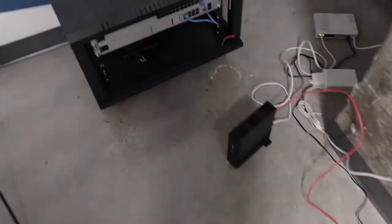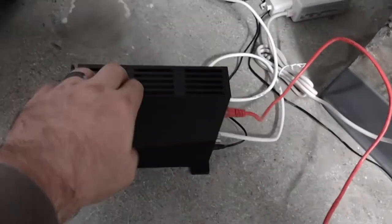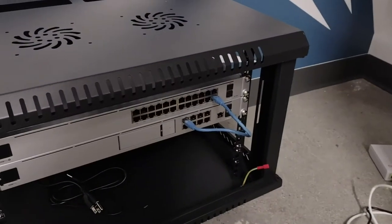I'm going to take out the Frontier provider router. This thing is basically horrible, mainly because they're going to have SIP-based hard phones, and it's sometimes difficult to turn off SIP ALG, which can create problems with phones.